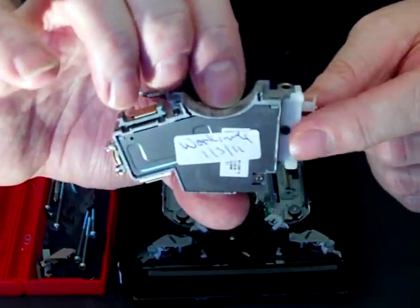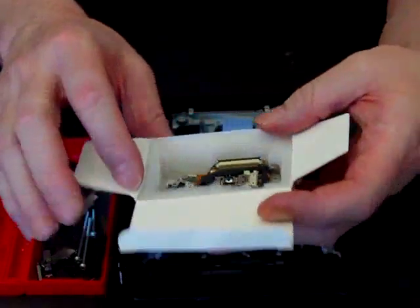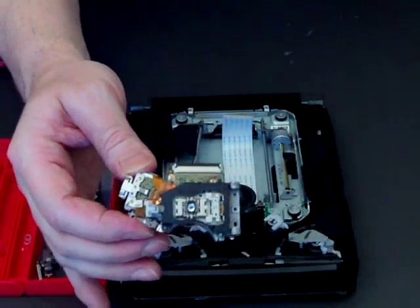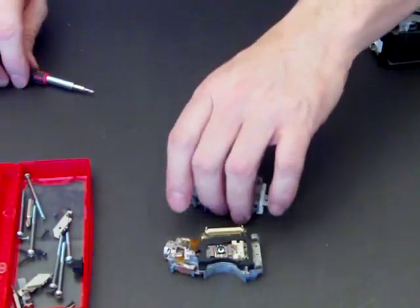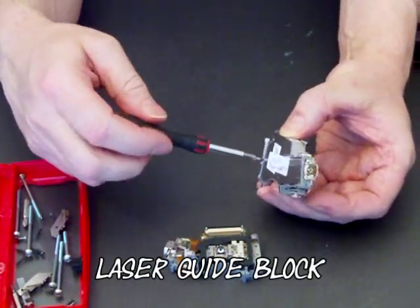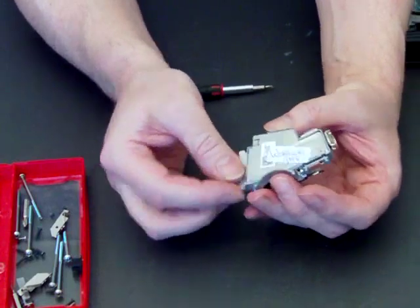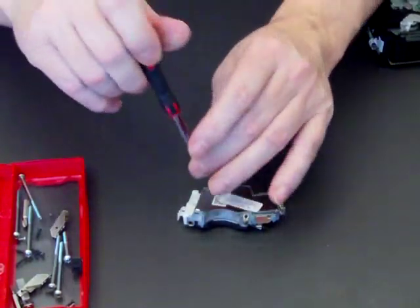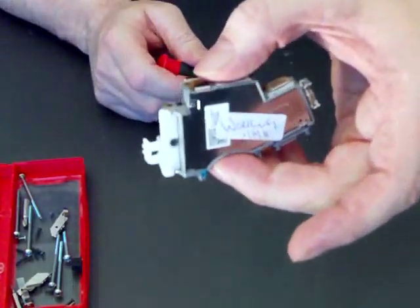There's a little mechanism where the guide goes through, and this little block needs to be removed and put on your new lens. Here's the new lens — this lens is actually working, I'm only doing this to show you. Be very careful as these are very sensitive and break very easily, so handle with care and don't touch the lens whatever you do. That's the new one, that's the old one. Remove this little block by taking the screw out — the same screwdriver basically fits everything on your Blu-ray. Everything I receive, no matter the source, is tested — even though this is a new lens, I've tested it.